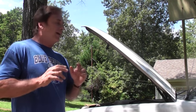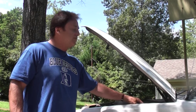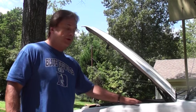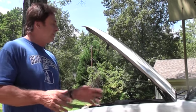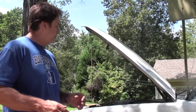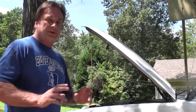What I finally hit on — and it took me a while — was that there's a major fuse up here besides the fuse box. They call it a battery box, but it's another fuse box up on top of the car, right in the corner. I looked through there a million times, pulled all the fuses, even tried the relays — nothing seemed to work. I bought a relay for the power control module — that didn't work either. But after all my frustration, I finally found a major fuse located right behind this battery box.